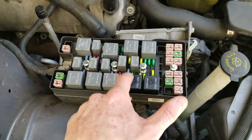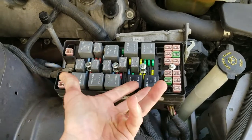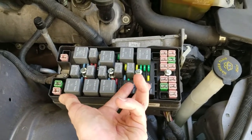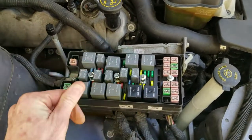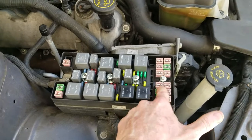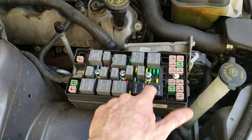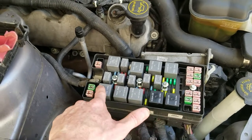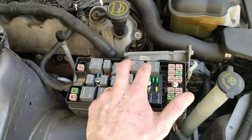So if you have put in more fluid and it is not working, you can try to switch these relays around to see if one goes up and one goes down. If not, go ahead and just purchase new ones, which we will be doing. They should cost — I'm not sure exactly how much. I'll try to have links in the description box below, or just go to your local parts store. Make sure you call before you head over there. Unfortunately, these ones are different relays — you can't switch these ones out. These ones are particularly for the top.